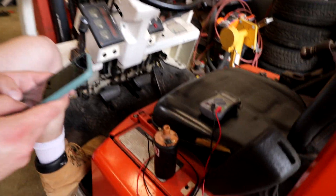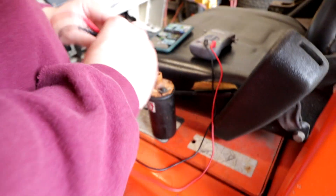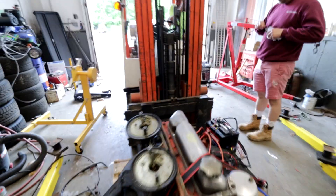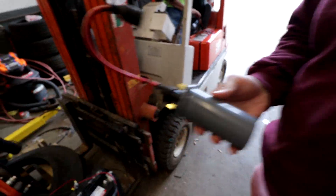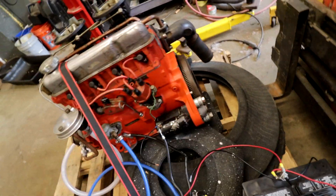It rained outside so we had to move inside. Jake's testing the coil because we've had some ignition problems - he seems puzzled. It does look old and crusty so we might need a new one. We weren't getting any spark at the spark plugs, then we checked at the coil and nothing. It's getting hot but it's not presenting any spark. Back from the store - got a starter that resembles the old one. Funny that we were having trouble getting the starter to spin and WD-40 and silicone made her spin so much better.